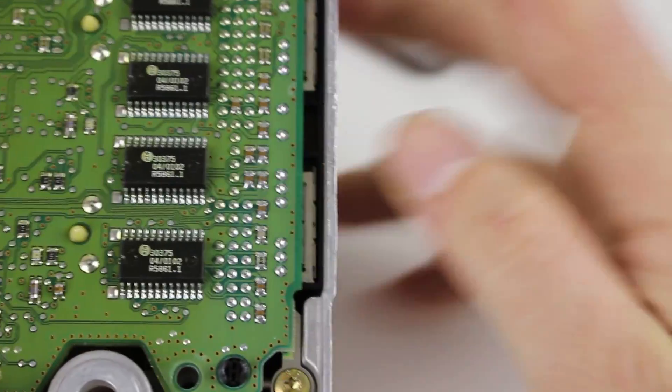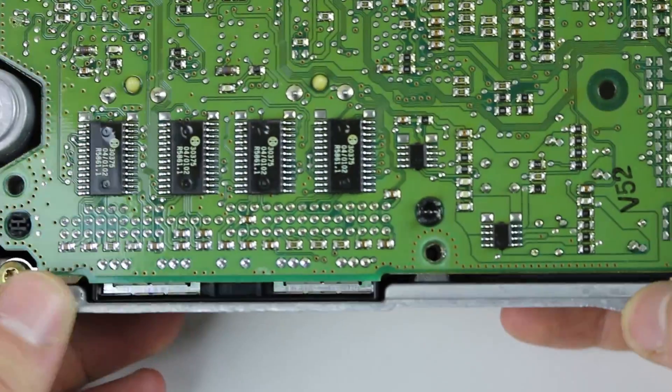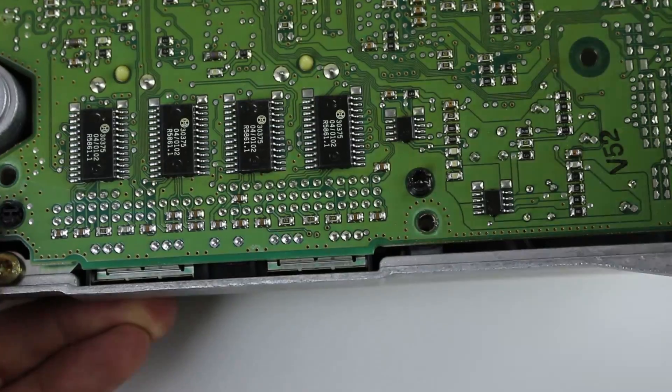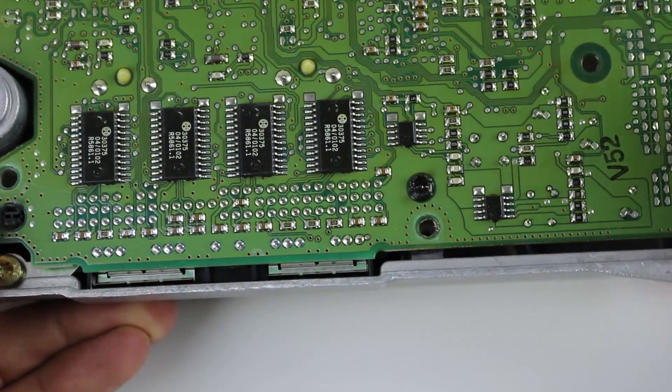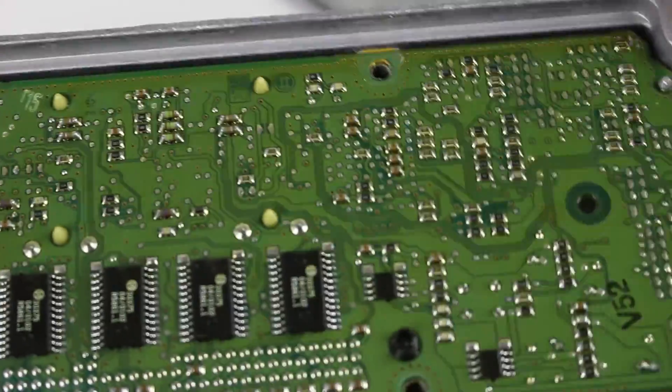There are some devices down there. This connector here - you can see all of these lines - that's the connector on the other side going to the CAN bus, and it also connects directly to the various airbag modules. So this connector right here will fire them as well as talking back to the computer.